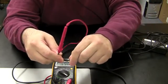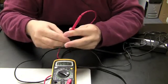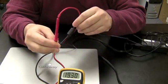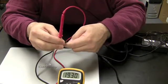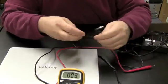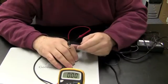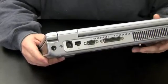Just to make sure, take the power adapter and bend it around a little bit to confirm it's making a good connection. I'm still getting 19 volts while jiggling it around, so we know the tip is good. A lot of times the tip will break right near the end and you won't get that 19 volts. So test the power adapter first before taking the whole computer apart.